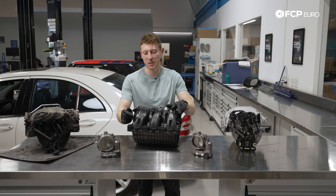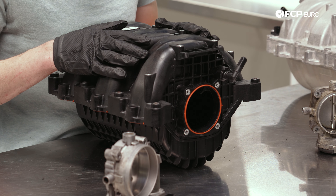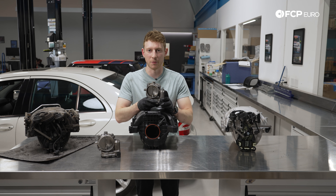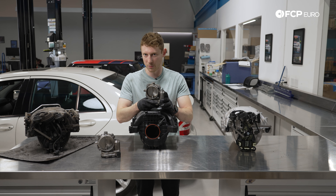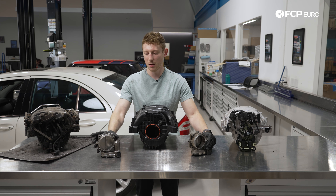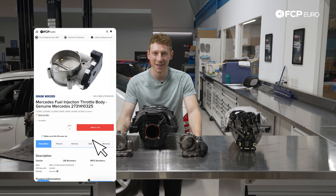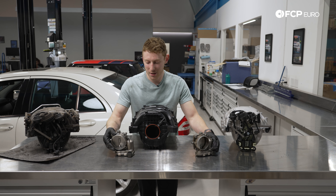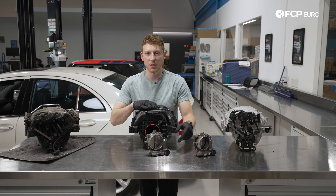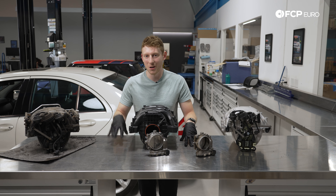These being a factory piece of equipment on that M014 sport package SLK, this inlet for the throttle body is actually larger than it ever was on any other M272. The standard M272 throttle body — the same as the M112 or M113 — is 74 millimeters and will bolt directly onto the stock manifold, but not onto this one, because this is upsized. This right here is an 82-millimeter unit off of an M273 V8. Mercedes essentially went into their own parts bin and robbed it from the V8. It bolts directly onto the M014 manifold — bigger throttle body, bigger intake manifold, zero deterrence from air moving through it.